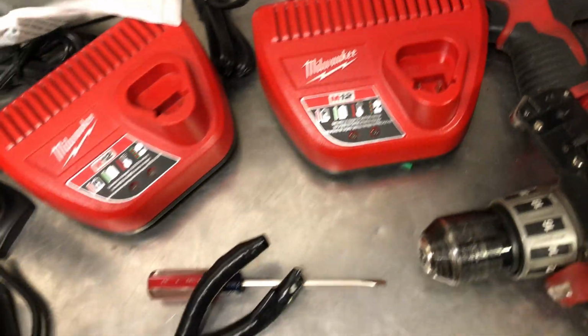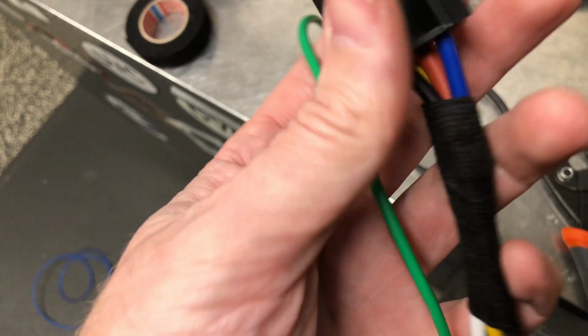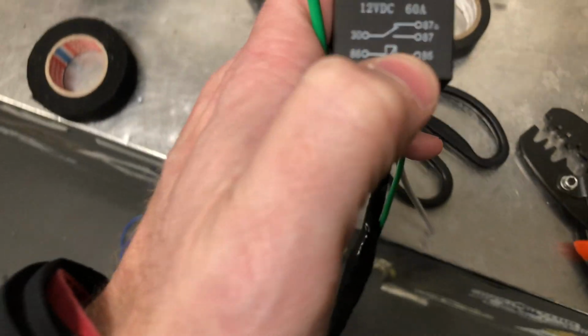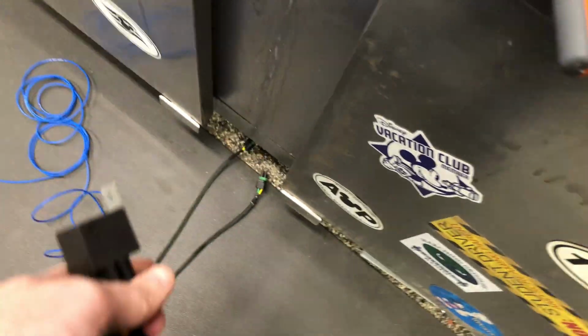So then I've got my blue wire that's going to go to the battery, and the reason it's blue is on my relay. This is a relay with a harness. Again, I'll put a link in the description. So this blue wire goes to the battery, which if I remember correctly is 80, or no, sorry, that's number 30. And then 87, which is the yellow wire. That yellow wire splits off, and that goes to the power on the connectors. That's actually going to go directly to the light.